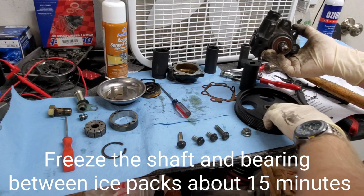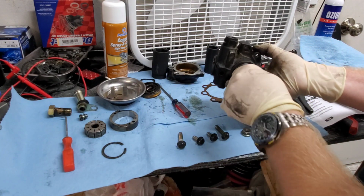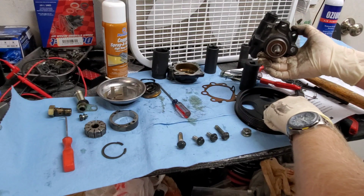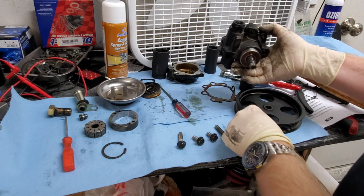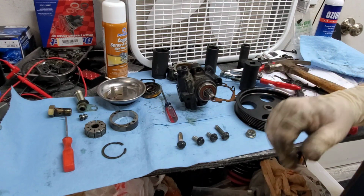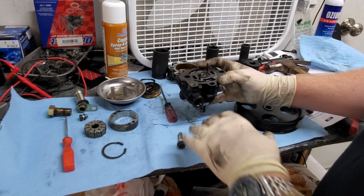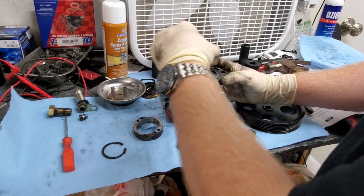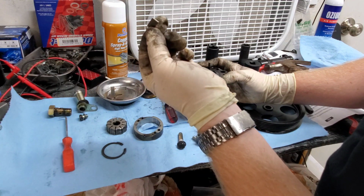You could even put your C-clip back on, your new C-clip, and put your pulley back on, nut, lock it, tighten it down to the torque spec. I don't have that in front of me at the moment. I'll leave that in the description. And then from there, you're going to turn it on its face with the pulley. Slide this back on, this back in. Put these little guys back in.